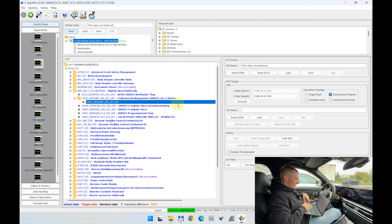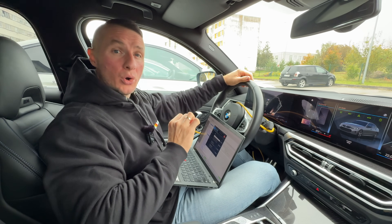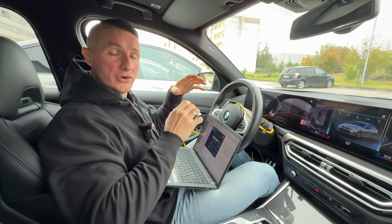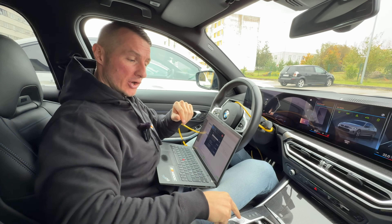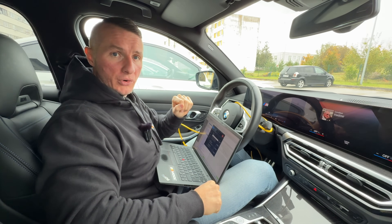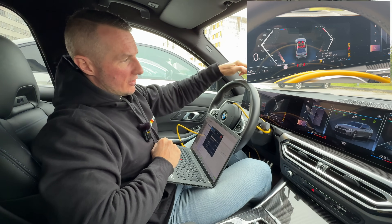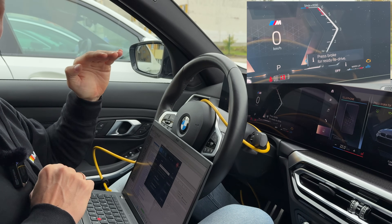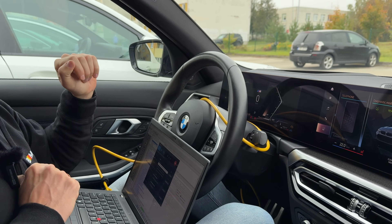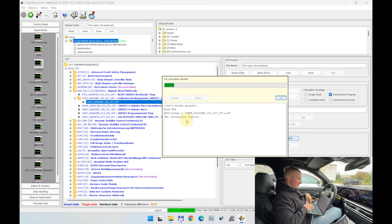Before pressing Code, there is one super important detail. Usually when working in the car outside the engine is running, but it is not allowed to code the engine ECU while the engine is running, because during the coding process the ECU will restart and it's not a good idea to restart the engine ECU while the engine is running. That's why you must turn off the engine and turn on diagnostic mode. On G-series this is done by pressing the start-stop button three times quickly. On the screen you can see that diagnostics mode is active — check engine light is on but the engine is not running. Now you are safe to code your engine ECU.